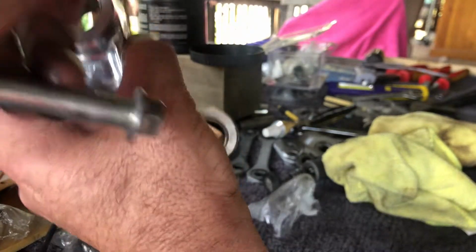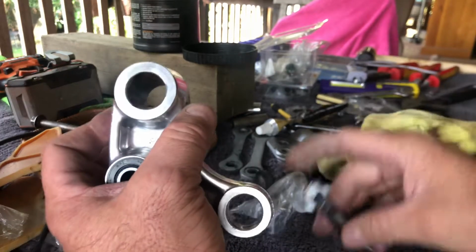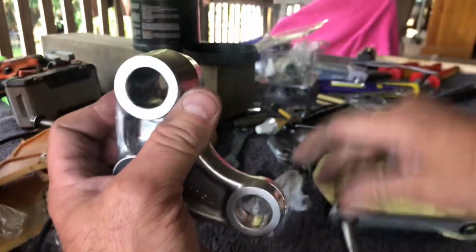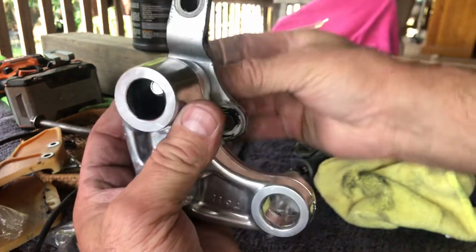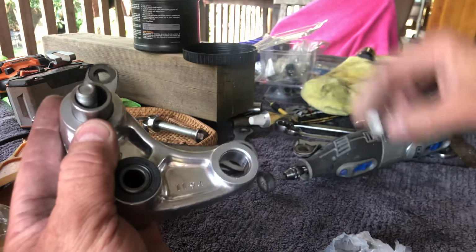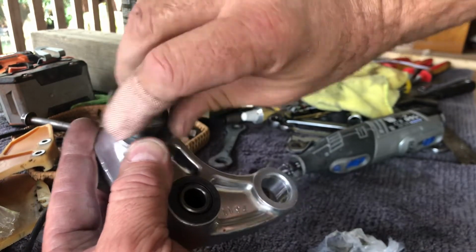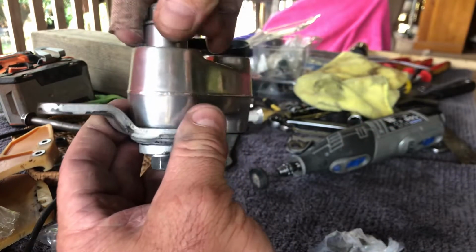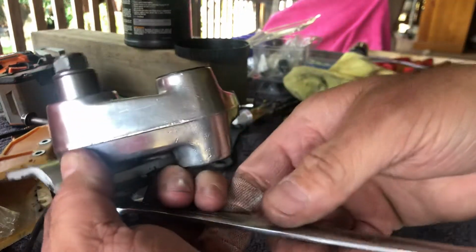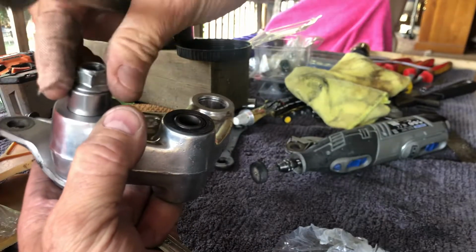The factory swing arm bolt on most bikes is usually a pretty perfect fit for in there, as you would see. So we're going to be using the swing arm pivot bolt and spacers to take up our space. Set our bearing on like so. The nut, make sure everything's clean before you start all this, and just get it started. Then we worry about lining things up a bit. We want everything pretty well in line so it looks good. And here we go. Make sure everything's nice and in line, so it presses evenly.